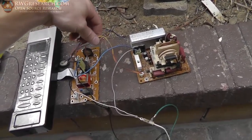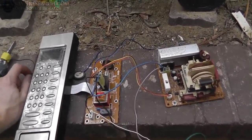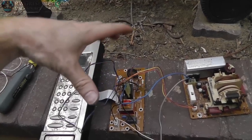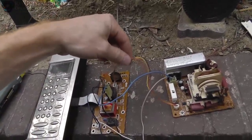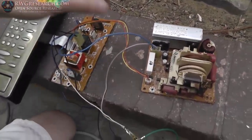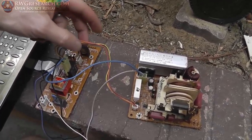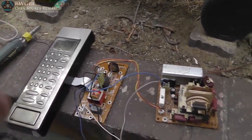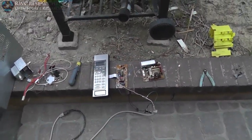What I should do is figure out what kind of signal comes in here by probing it with the oscilloscope, and then I can just activate it without any of this. The safety circuit's built in over here, so if we can bypass this safety circuit by just introducing a voltage — I don't know if it's a pulse width modulated thing or just signals — if I can just activate this it might even be just a short to ground. Let's check that with the oscilloscope or the meter. Then we can just run it for five minutes and see if it blows up.